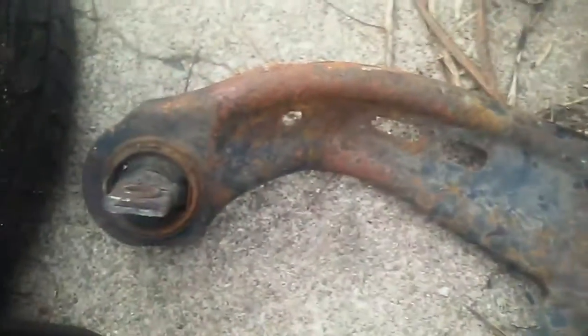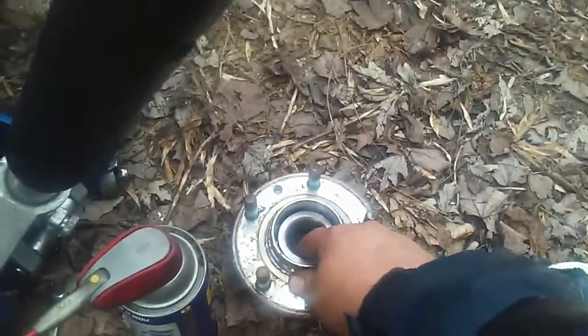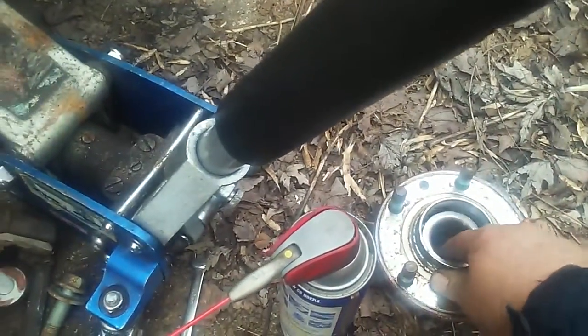This thing went sliding over a hill down into a ditch. The wheel bearing itself seems a bit loose when it rides on that spindle right there. The one in here seems to be not so good — I don't think it should have that much play in it, but it might just be a separate issue.